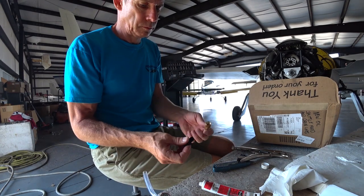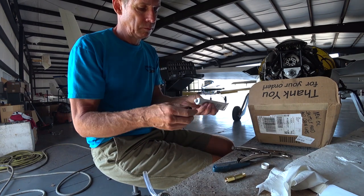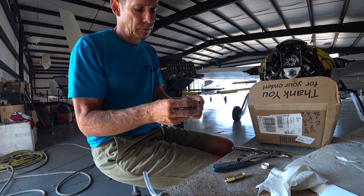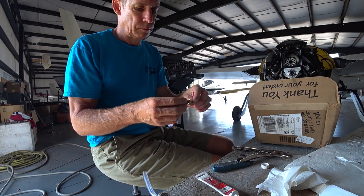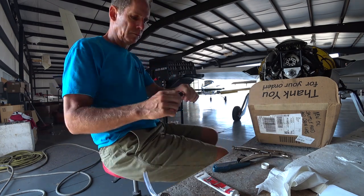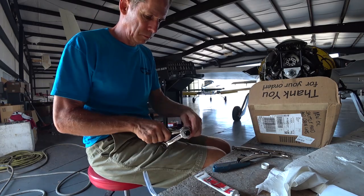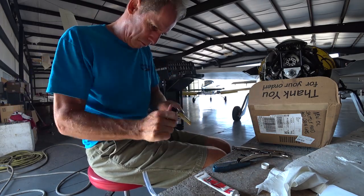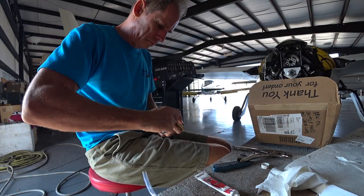There I put the little coupling on the end of that little pipe — it's a nipple, that's what it is! Funny how it came back. So I had the nipple on there with a coupling, and then putting the AN-to-NPT adapter on there and tightening those all down. That one's all ready now, just to screw into the top of the coupling, and then the existing oil feed line from before will just screw into that.